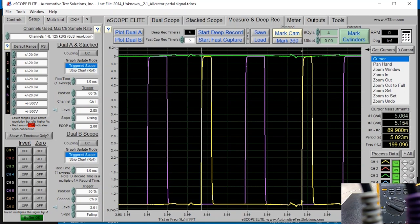That's why you also see a change in voltage between the two signal wires. For example on the yellow trace, when that voltage value stays on longer and expands out, your multimeter is able to average enough to pick up that voltage. The same concept applies to the purple trace as well - they both work on the same principle.